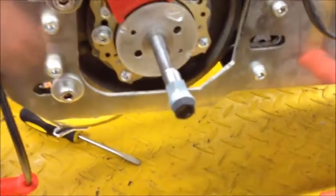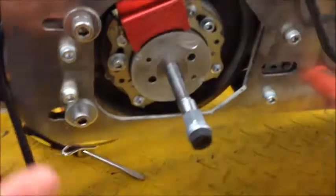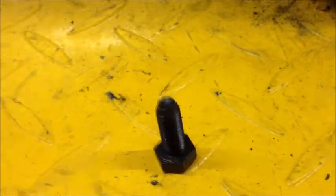This nut falls in and then clamps the variator plate in place, locking everything in place. Into the 3D nut go these 10.9 grade heat-treated M8 bolts, and these should be strong enough for everything. So yeah, let's see what happens.